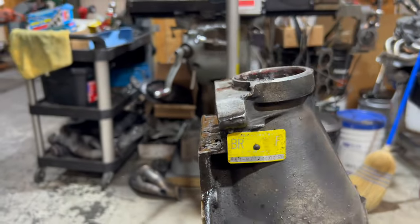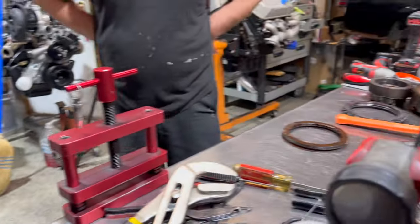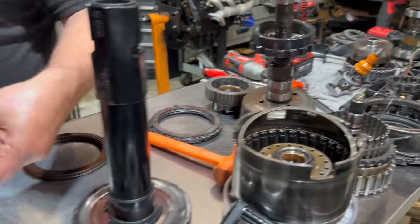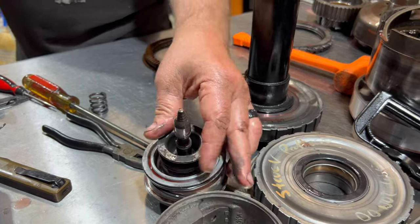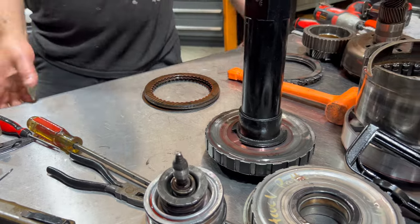BRF. And the key to that is the unmolested springs in the transmission that makes that possible. When you start messing with springs, like people will leave these out or they'll change them, and then you just screwed up your 3-2 and 2-3 shift timing. And then they go in the valve body and they start messing with springs and they screw that up. There's only a couple changes that need to be done in the valve body.